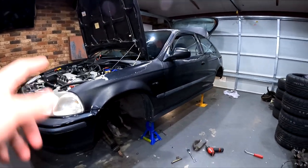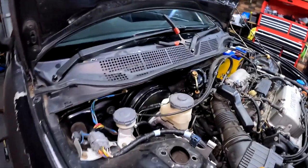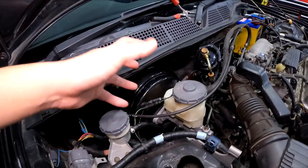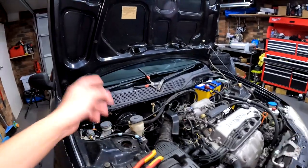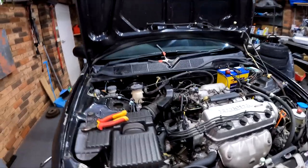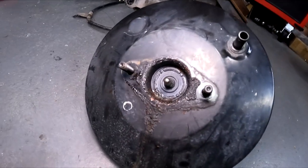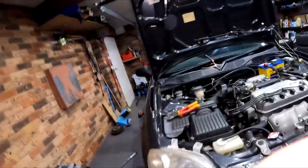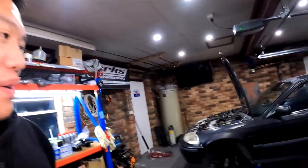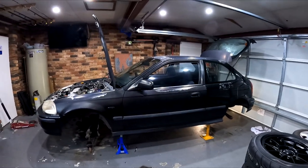All four corners off the car, ready for our new parts. Off camera, I also went and swapped out the master and the booster. This actually took quite a while because it's really hard to get the booster out and replace it with a bigger booster - not much room. I removed the leg off the booster and it did go in a lot easier. I'm pretty happy I caught on to that because when I pulled off the old booster, I realized there's a bit of fluid leaking from the master there. Very lucky. I'm going to pack up and call it a day.